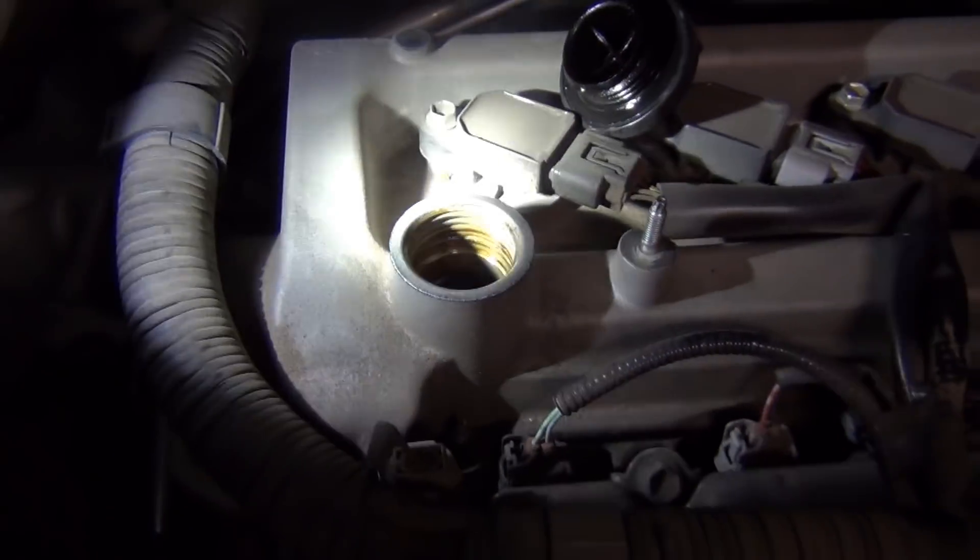There wasn't a whole lot of leaking from here, and part of that is because this coolant coagulates — coagulante is freeze in Spanish. Basically it heals, just like a scab. You can see where the coolant was leaking from this water pump from that weep hole. That weep hole is to protect the bearing — you've got liquid on this side to keep cool, and then you have a sealed bearing on this side. If this liquid gets to the bearing, it rusts out and ruins it. There's a seal between the two, and when that seal goes bad, there's an exit point at the bottom of the water pump to let the coolant out so it doesn't get to the bearing. It'll overheat your car but it'll also make a puddle and smell to indicate that you've got a problem. But if it coagulates and goes right past the hole to the bearing, then you get what we had here. The coolant that came out is that pink stuff — it coagulates great. Toyota loves it and for good reason — it lasts a long time.